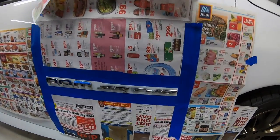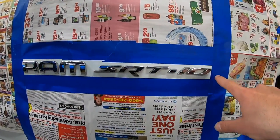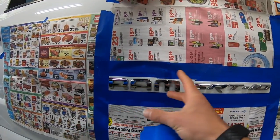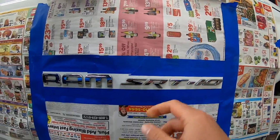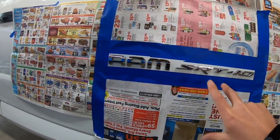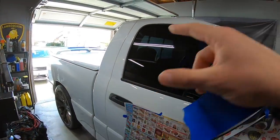All that is masked up. I left about a quarter of an inch or so around the perimeter of the emblem. What we're going to do is spray completely across the whole area, and then when we peel it, it's going to break right at the actual emblem. I want to make sure there's no overspray on the actual vehicle, so that one's done — we'll move around to the back and other side.